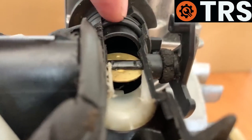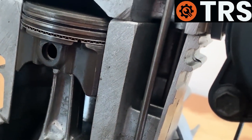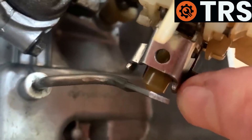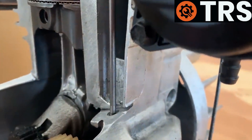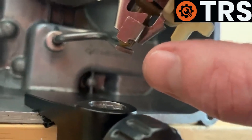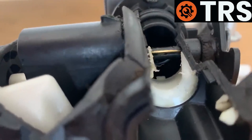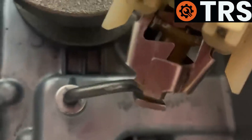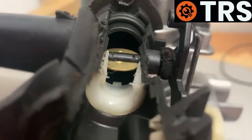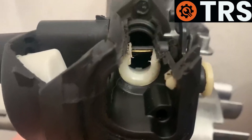The engine starts on full throttle with maximum airflow. The engine turns and gets up to speed, but rather than revving high enough to damage itself, this mechanical governor system kicks in, adjusts the leverage, and closes the throttle plate accordingly, thus lowering the revs and saving the engine. This system wouldn't be just either fully open or fully closed — it also works intermediately, depending on how fast the engine is running, so the throttle plate adjusts accordingly. When the engine starts to slow down and the gear slows down, the spring takes over, lifts the lever back up, pushes the plastic centrepiece back into place, and that opens the throttle plate once again. Left to its own devices without any external movement of the throttle lever by the operator, the engine would find a happy medium at which it would run.